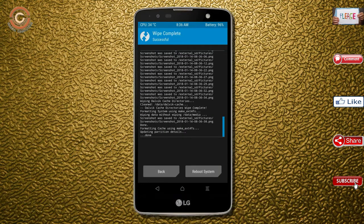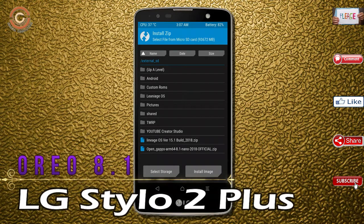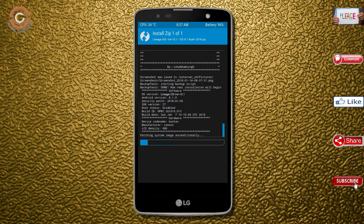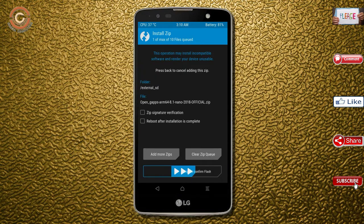Now go here to install the ROM. Press back and find Install. Select Oreo 8.1. I have provided the latest version of the custom ROM and GApps suitable for your device — please find the links in the description below and download them. After selecting the Oreo 8.1 ROM, swipe right to install. Then press back, select the GApps, and swipe right to install.